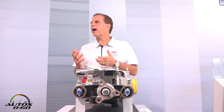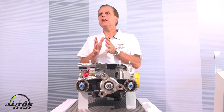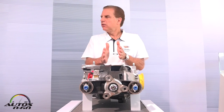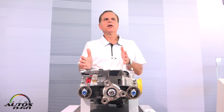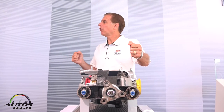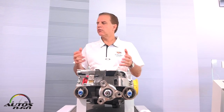Yesterday one of the journalists asked why aren't you doing brake-biased torque vectoring. If you think about it, brake-biased torque vectoring means it's braking or slowing you down to add vehicle stability. It's a tool that works and adds stability, but it doesn't add maximum acceleration. With the ELSD, by not relying on the brakes for stability but relying on power instead, I can use power to stabilize the vehicle — adding power to the wheel capable of straightening it out, as opposed to using the brake and taking acceleration away from you. This is a faster and more driver-friendly approach to stability control than just brake-bias methods.